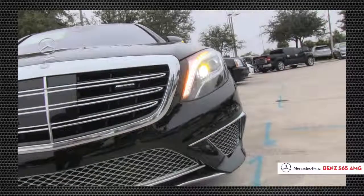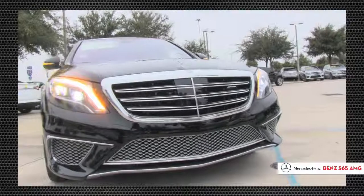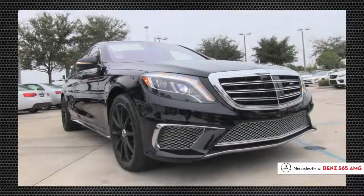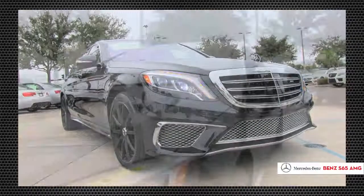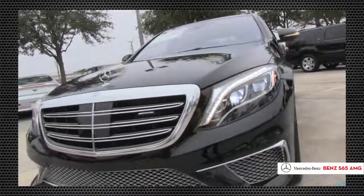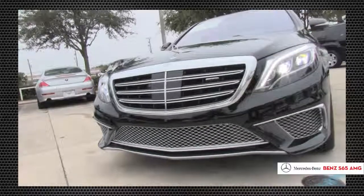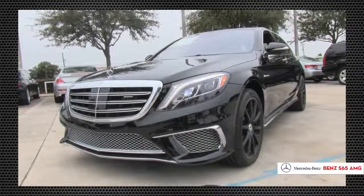of aluminum construction. Torsional rigidity has also been improved by 50%. For the first time, all body panels, including the roof, are aluminum. Aluminum also makes up many of the suspension components and structure, helping aid in decreased unsprung weight that's further facilitated by forged wheel offerings. Lightweight, high-strength tensile steel makes up the majority of the passenger compartment for an extra level of protection and rigidity. Even the seats are lighter.